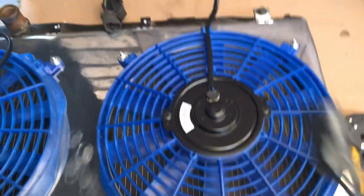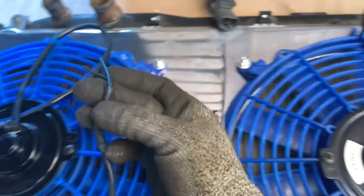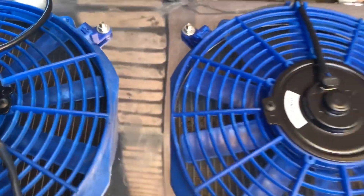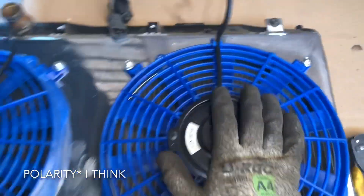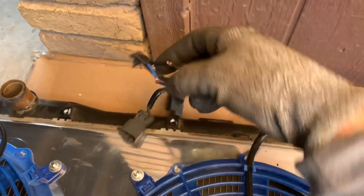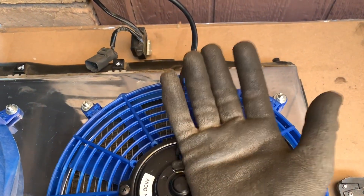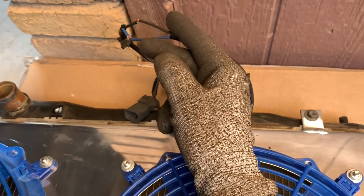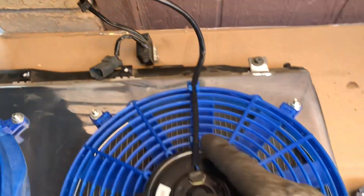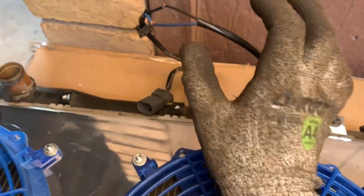Alright, so I went ahead and cut both connectors from each fan, and I did go ahead and tested it with the car battery. Blue and black — the way they're color matched right here — it does match the continuity to pull air. So if you're going to replace the factory ones and put them on behind or inside the radiator, that continuity is correct: blue to blue, black to black. But if you're going to put them in front of the radiator — hence, push air — you would have to swap these two colors, so blue would be on black and black on blue. That makes sense, just to reverse the spin cycle of the fan. I'm just gonna solder these, electrical tape them, and make sure they're real secure.